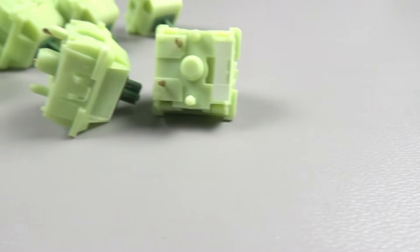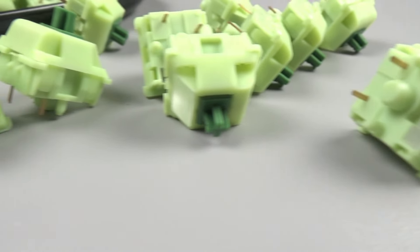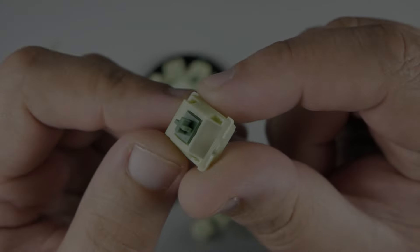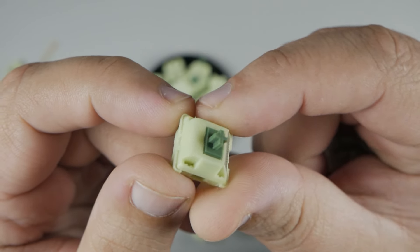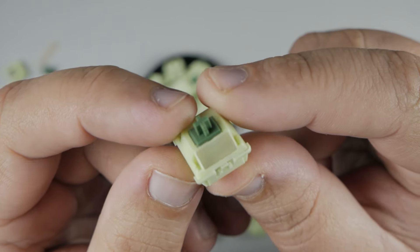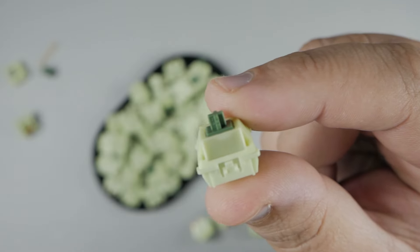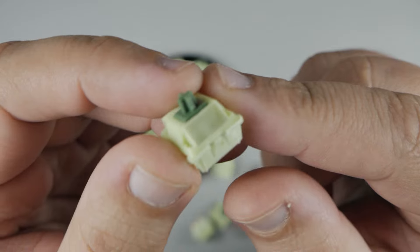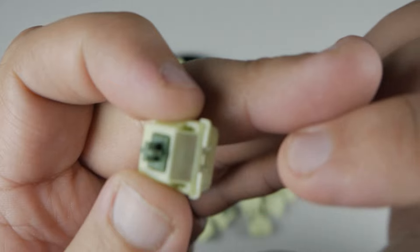So let's talk about them. First, I noticed a little bit of leaf tick, but honestly I think you could fix that with a little more lube or a little more love on these switches. Second, the factory pre-lube is really minimal and some switches didn't seem to be pre-lubed at all. With that said, they did feel smooth out of the box and I didn't notice very much scratchiness, but I would definitely recommend lubing these. I did really enjoy the switches — at 67 grams they had a really heavy tactile feel, which has been up my alley lately. Also, the bottom out wasn't harsh and was really smooth, which I enjoyed.